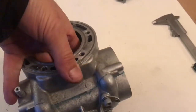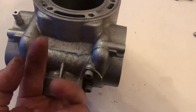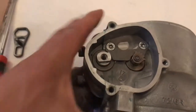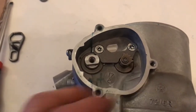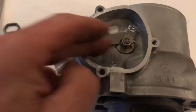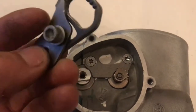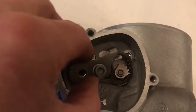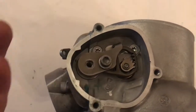At this point just check that your power valve moves freely, because it should be completely free to move around in there. That moves around fine. Now onto the next stage - we can put these side arms on. The arm should just go on since we haven't moved it; it's still at full bore, which means when the power valve is pushed right to the top, the bracket should just slot straight on. This is the bracket we took off - I didn't loosen this because the Z dimension was already right. It fits on perfectly, so you now know those two are timed up right.